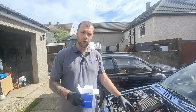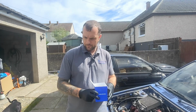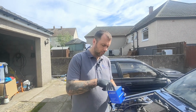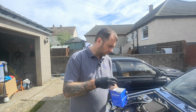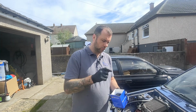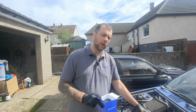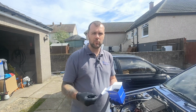One thing I did was I took the distributor cap off and inspected the little points on it. We noticed that they were a little bit corrosive and we tried to rub them down. So I took the distributor cap off and tried to put a new one on. I had ordered a new rotor arm and a new distributor cap for the car. Because of the intercooler and all that in the way, I decided just to change the cap and leave the rotor as is, just for time saving at that point, to see if it corrected that issue.